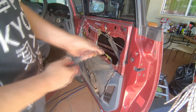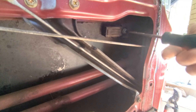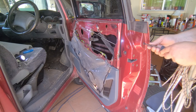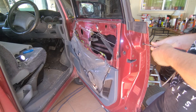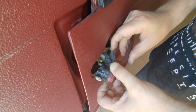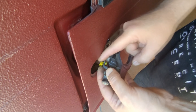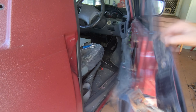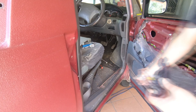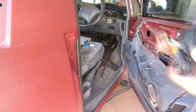That one you'll get in a minute. We've got one screw here that needs to come off, another one in here holding the middle part of the handle on, and there's one more screw on the back here. Now with everything loose on the other side, just take the handle out - comes out easy enough. Now I can get access to this other clip here - that's the clip I want to just pull back, take that out, and the handle's out. As long as you put in that extra effort of removing this runner to get yourself some access and undo those two clips properly, the handle comes out really easy.